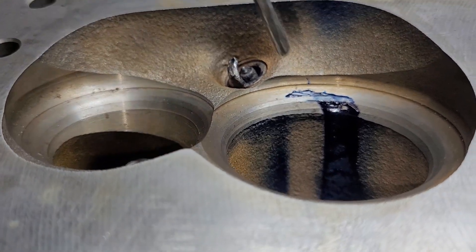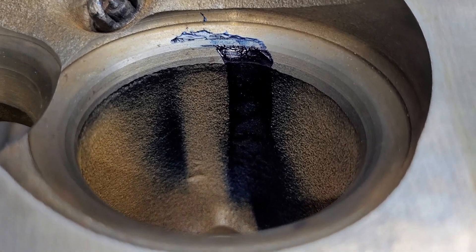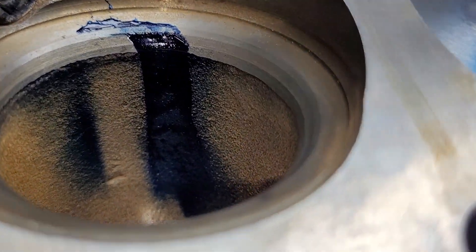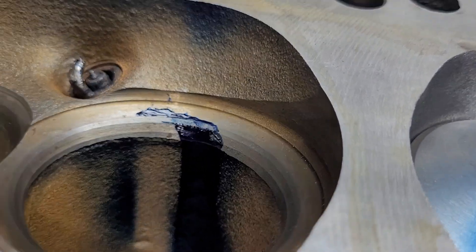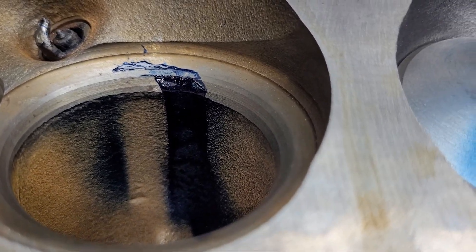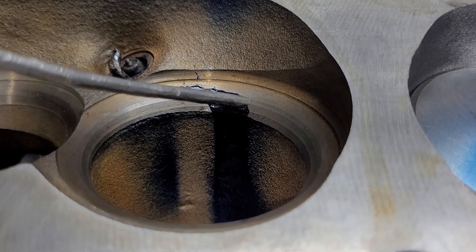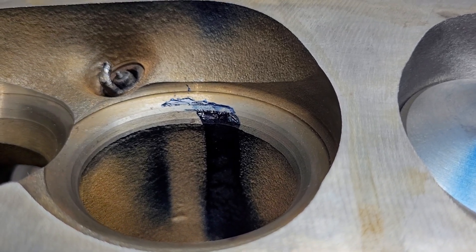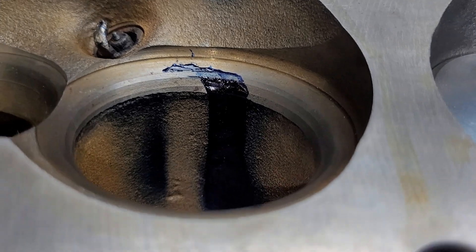I don't see anything around the plug — very little on this side, just a shadow. Now when I did the ports, I did pay attention to liquid flow. What I was trying to do is get more liquid on this side and more liquid on this side if possible, because the more you spread it out, the finer the droplets would be. If it's the same volume of fuel, would you rather have one thick stream or have it spread out wide? I would think spread out wide.